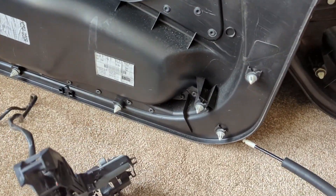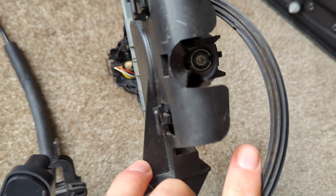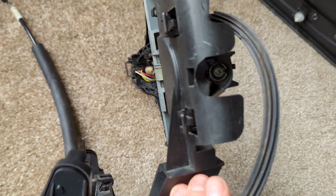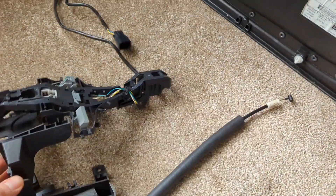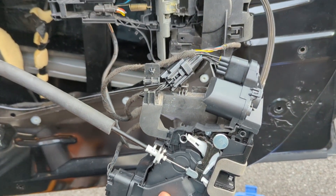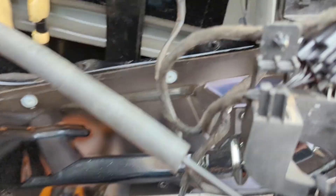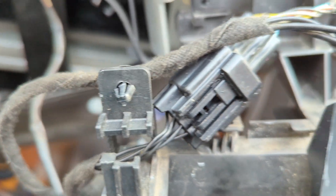On both the front and rear, on the inside of the handle there's a Torx piece — you will need a long screwdriver with a Torx bit on it. That's the bit to release the handle on the outside. I'll show you that in reverse as I put it back on. Now we're outside — this is just re-plugging back in again. You've got a plug up here, a plug there, and a plug there. I've got the little one up inside where the door handle is. That cable needs to plug into the back of it. The best thing to do is make sure the cables are routed so that the window can obviously go up and down and the cables don't get in the way.